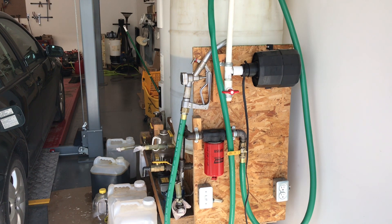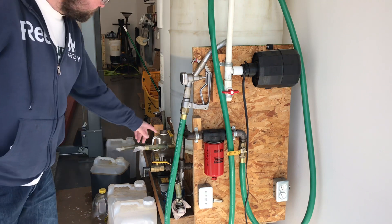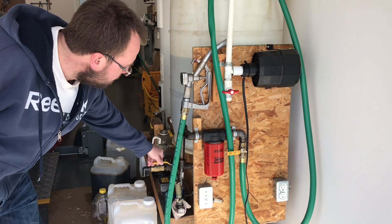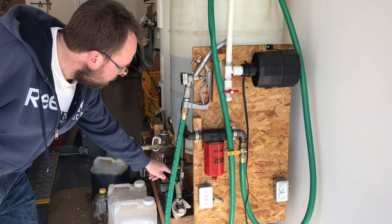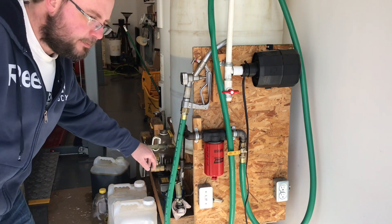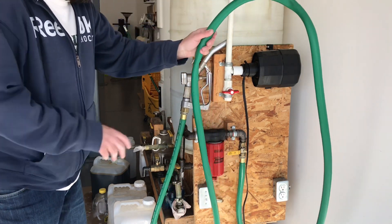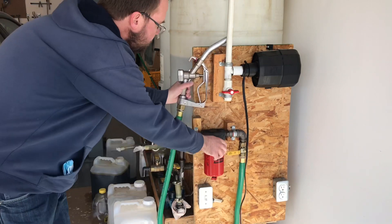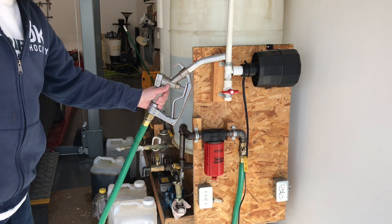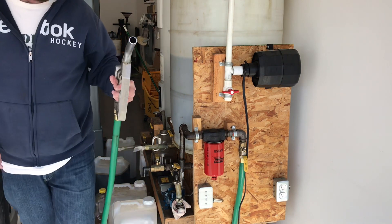And now the final step. Now that the fuel is done in our finishing tank, from the standpipe we come into the pump. We can open up this valve to let fuel into the pump, and then out of the pump through this farm filter — I think it's a 10-micron filter. This valve can be open as well, and then into the car. You can gravity drain it, which is what I'm going to do here because I have some extra time.